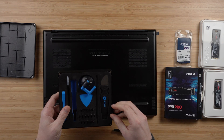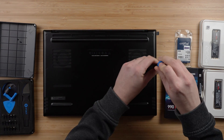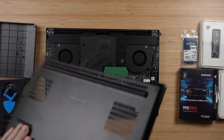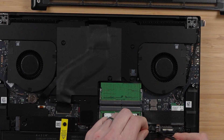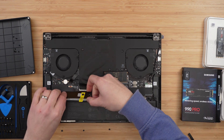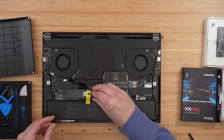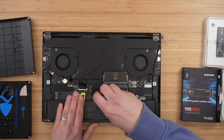I'm using my Razer Blade 16 to demonstrate this installation. This laptop is incredibly easy to get into — it's just a few T5 screws on the base panel. Once you've unscrewed those, pop the cover off and unplug the laptop battery to avoid any shorts. Then unscrew the existing SSD, slide it out, pop in the new Samsung SSD, screw it down, put the heat plate back on, plug the battery back in, and screw the base cover back on.